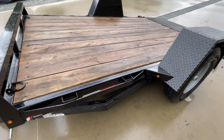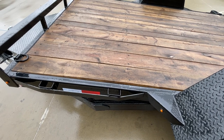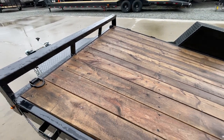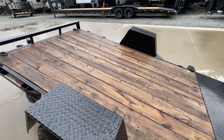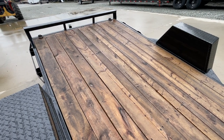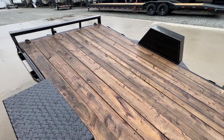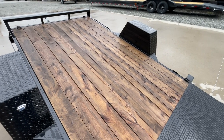There are lots of tie-downs on this as we move back the trailer. You've got stake pocket tie-downs, rub rail, and four D-rings — lots of different ways you can tie down. We do the oak decking on this for a few reasons: this is a trailer that some folks use pretty often, and oak is extremely durable. It's also rough cut, so we think it's going to give just a little bit better traction when you're trying to load smooth-tired equipment.